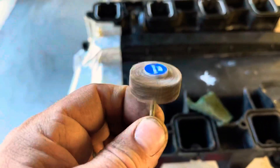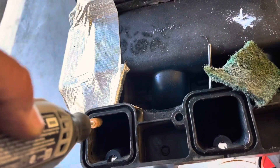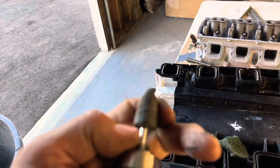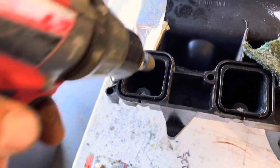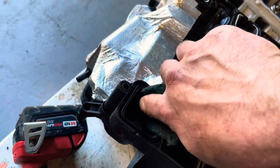The first wheel I like to use is the 80-grit flap wheel — the CN flapper. I get the majority of material with this, but be careful because it digs pretty quick. Then I slap on this little bit that does my corners and helps me open up anything else I need around there. Then I put this stone on my drill at high speed — it's a stone that can get down about an inch and a half and smooths everything out really well. Then I use a scour pad soaked in throttle body cleaner and spend about a minute going around smoothing everything up as far down as I can.